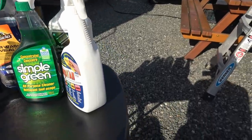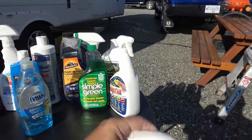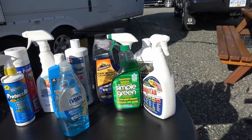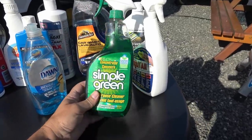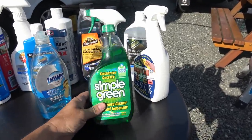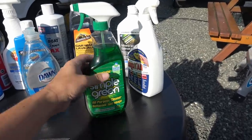I found that the black streak removers they sell at RV stores are almost useless — they hardly do anything to kill the black streaks. But because I'm going to be re-waxing at the same time, I found Simple Green works really well, just straight concentrated — it wipes them out really quick. Of course it'll also strip the wax, so you're going to have to be re-waxing at the same time.